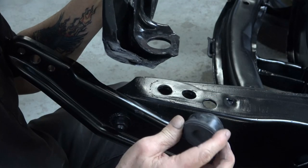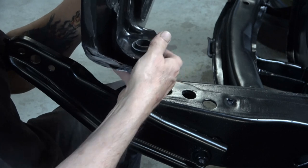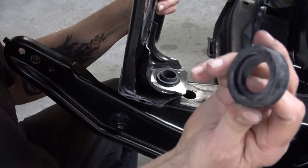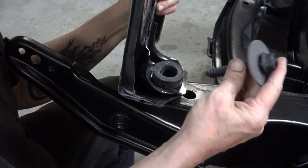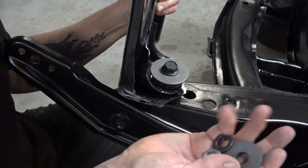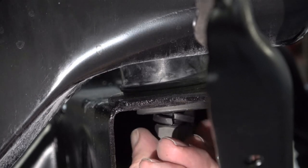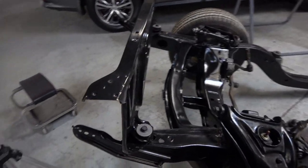The bolts and nuts have the correct factory markings. I'm putting in the core support bushings right now — you just put the thick part in first, then the mating piece on top, then the bolt and nut. I like to put the core support in as well because it helps line up and square off the subframe. Once it's all bolted in you want to bolt it in loosely, then go through the measuring and get it all squared off properly — I'll be covering that in probably the next video.